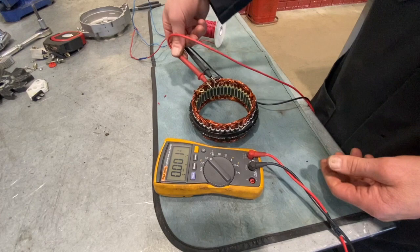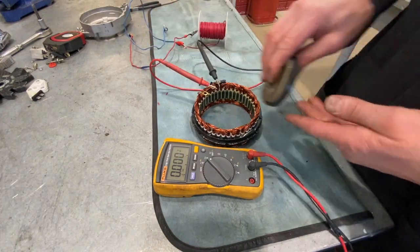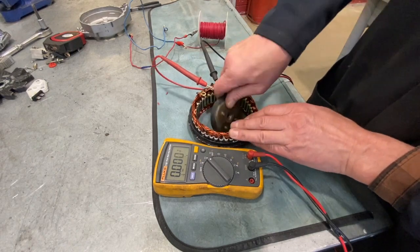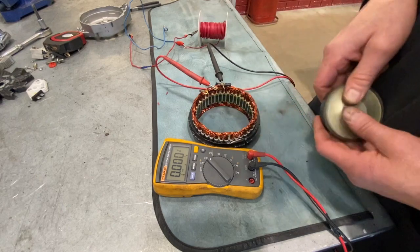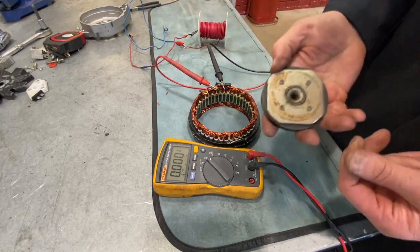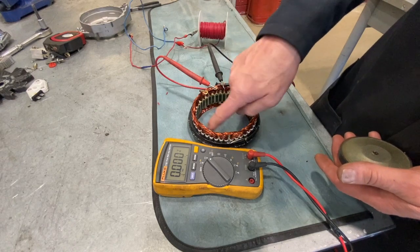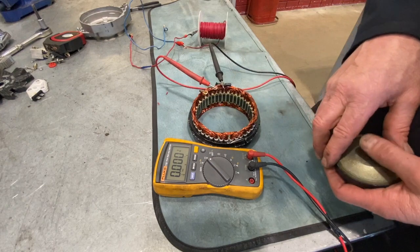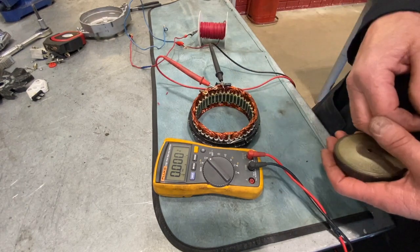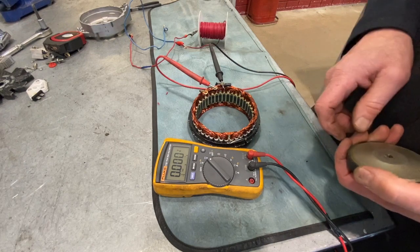As an experiment, we're going to hook our voltmeter up to one branch of the stator, and I'm going to pass a magnet inside and rotate it. You can see that starting to create some voltage signal out of there. The faster I can turn it and the stronger my magnetic field is, and the more of those windings I can cut with a magnetic field, the more voltage output I'll have coming out of those leads. So a magnet passing a conductor induces voltage into the conductor — and that's how an alternator works.